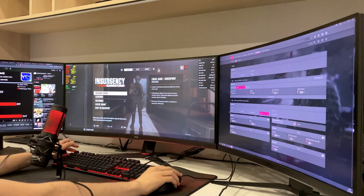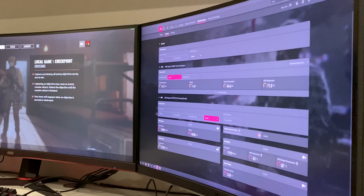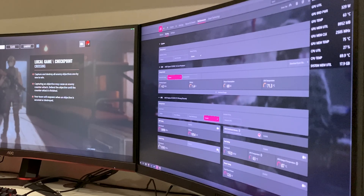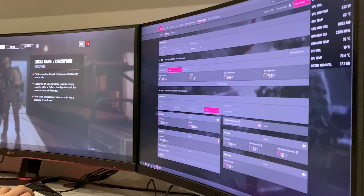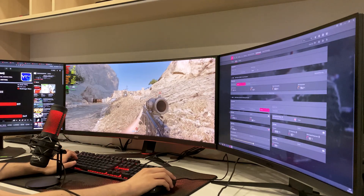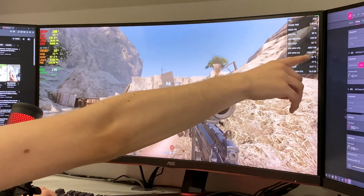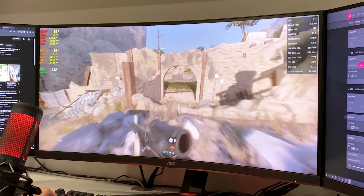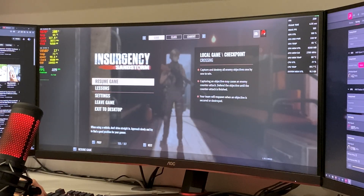In VRAM tuning, I was told we can go with 2800. I'm going to enable this, set it to 2800, and try fast timing. Let's apply these and see if it crashes. I've applied the settings — now it's at 2786, so the VRAM is a bit faster. Right now we're sitting at 340 watts for power consumption.